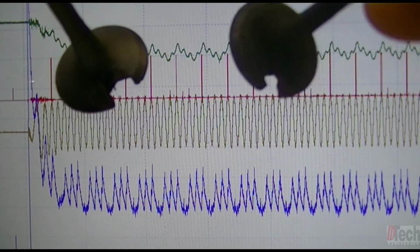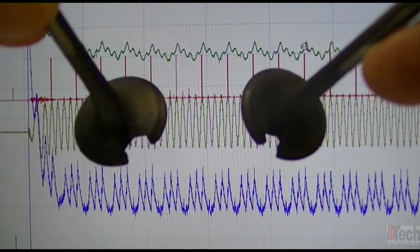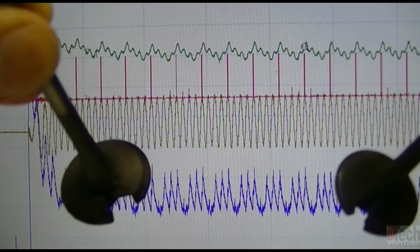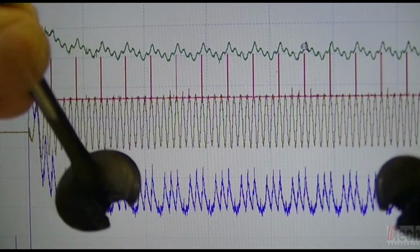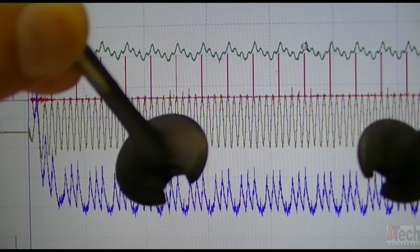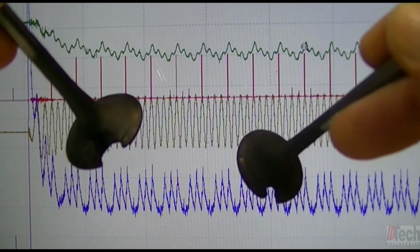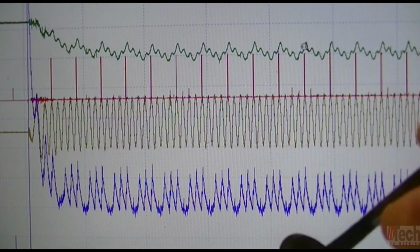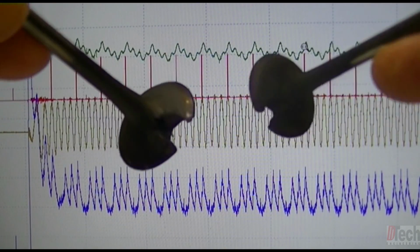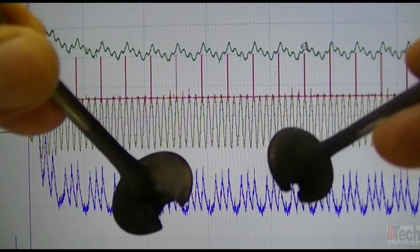I don't mean to beat this one down, like beating a dead horse, but imagine this being a bigger engine, more than four cylinders, a more expensive deal, and needing to make a correct call, or you're trying to find the bank-to-bank deal, and you have to decipher what's causing that. Is it from a cylinder on top dead center, or this, and that? This is another huge factor that you're going to have to keep in mind that can cause that trace.